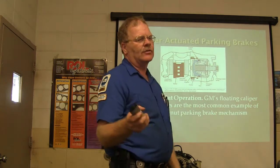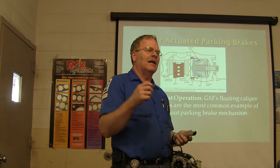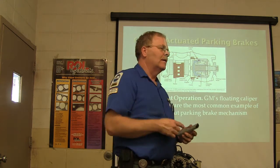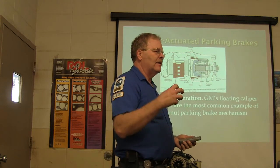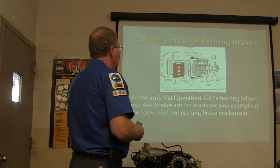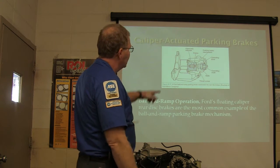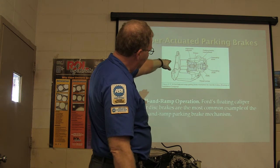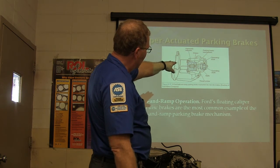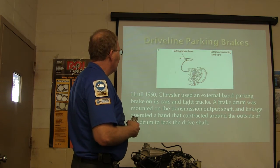Incidentally, in one of our brake caliper squeezers, people weren't greasing the threads and it locked up and got burned, and so I threw it away. So we gotta get another one. Which one was that? The one with the red handle? No, the one that had this wrench handle on it was messed up, it got to where it wouldn't move. And so basically, you got a ball and ramp. See, some of them have got a little ball and ramp operation, they're similar to this, but instead of having the screw operation, they got a ball and ramp deal. And, you know, you gotta run it back up about the same way.